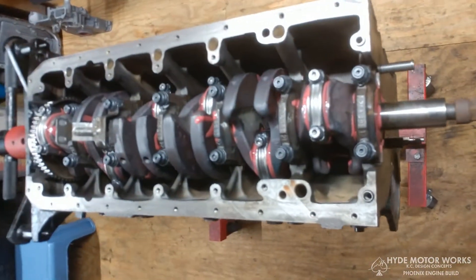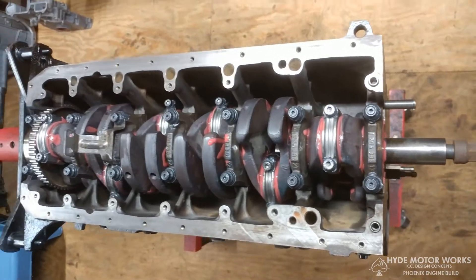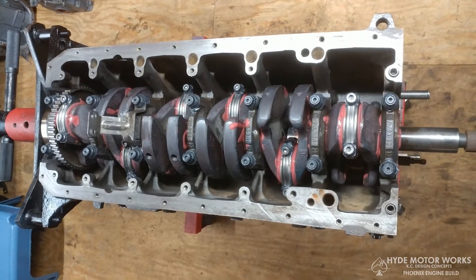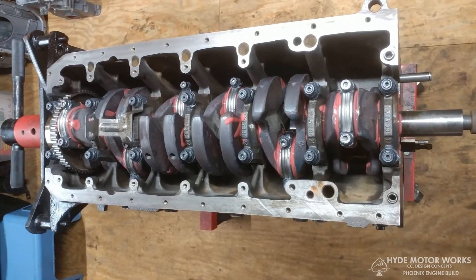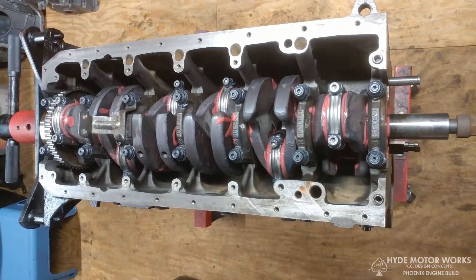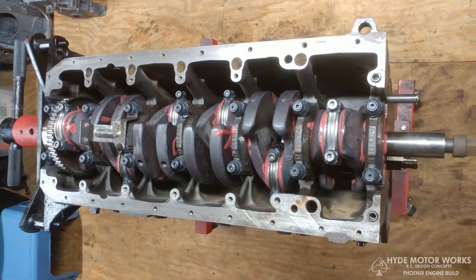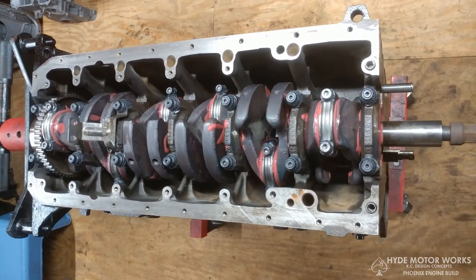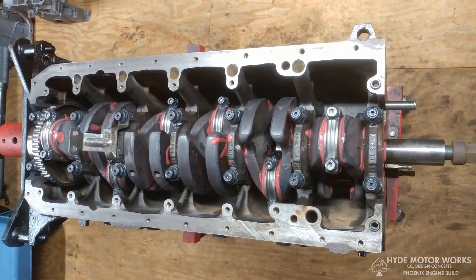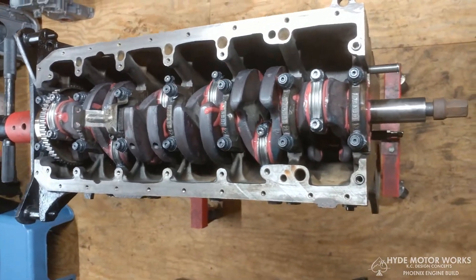Since we're going to build this engine up, I figured I'd give it a name. The engine I've been running in the car for the last three years, making around 400 to 450 at the wheels, is using a completely stock M54 B30 rotating assembly and the M50 block, with new rings with gap and bearings and gaskets, using a 140 head gasket to help lower compression. It's running good.